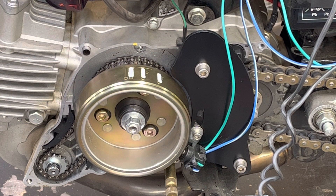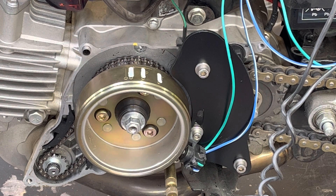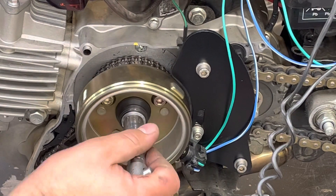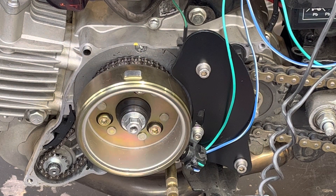Ideally they could do with a bit more advance, but on the safe side they work well. There's a big difference in cylinder temperature and external temperature between being retarded and having that much more advance. Hopefully this video clears things up for those asking why it's advisable — it really does help the top end, mid to top, and just initially off the mark. Engines love a bit of advance early on.